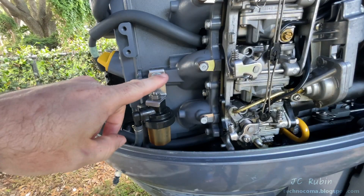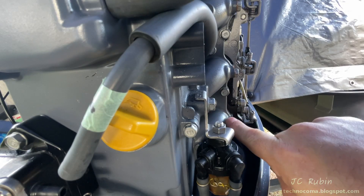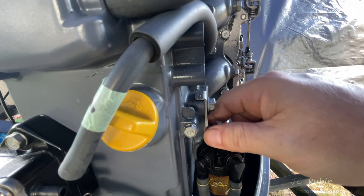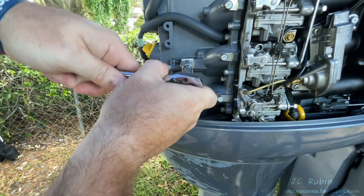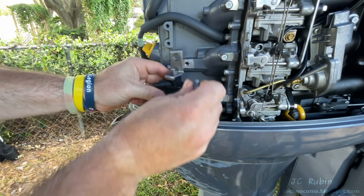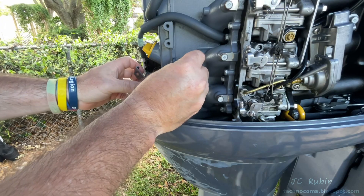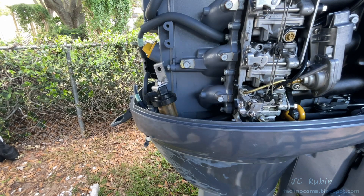This is the mount for the fuel filter. Though we're not going to be disassembling the fuel filter in this portion of the project, we can see how it obstructs these bolts that we're going to be removing shortly. So we're going to remove the fuel filter from the engine off this mount using a 12-millimeter, unscrewing it, coming off the mount, and then putting that 12-millimeter bolt back into the engine. This will be a recurring thing — to not lose bolts and parts.